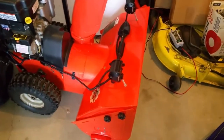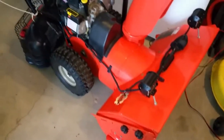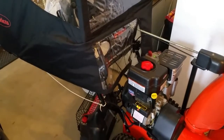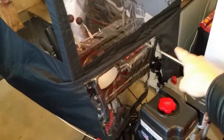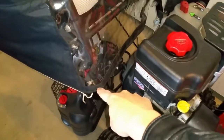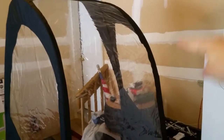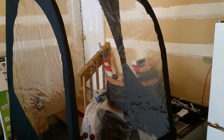Now I have two good powerful spotlights raised about four inches on top. The next thing to figure out is where to put the floodlights. I have a couple of options. The first would be to lift the cab a little and mount them right here, but I get a shadow from the chute. I'd prefer them up high. I could make a bracket at the handlebars, or mount a crossbeam to create a light bar above — that's probably the safest option.